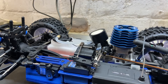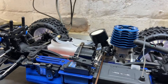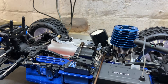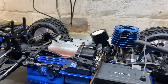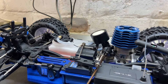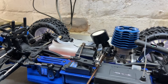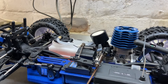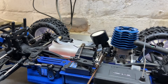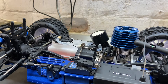Turn the car around — that's your low speed needle. We're going to do the same thing again. This controls your fuel mixture from when you're setting off at the low end, and it can also affect your idle as well. So turn that clockwise until it stops — again, don't over-tighten it — then three and a half turns back out: half, one, half, two, half, three, half. So you've got the base setting there.